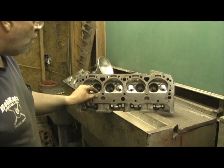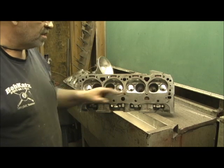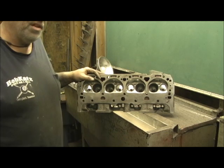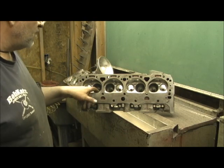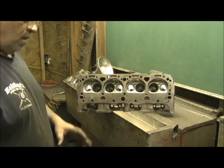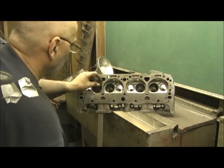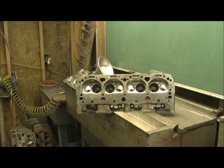No rough edges whatsoever — it's a perfect roll. That's a good indicator: if you get a set of heads unassembled with no parts in them and you can take your finger, roll around there, and feel no sharp edge — a perfect roll — that's going to be an indicator that the person who did the heads is a professional head porter. I can't tell you how many times I've stuck my fingers in heads that were supposed to have been done by somebody that knew what they were doing and felt that sharp radius. This is about the only way I know to come in here and get it that way. It takes a lot of time to get them exactly like you want, but when you do — that's all there is to it.